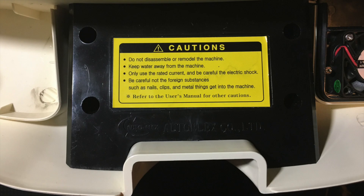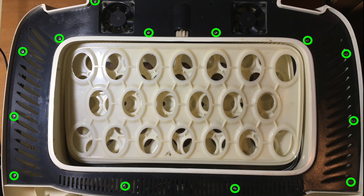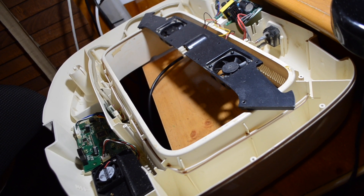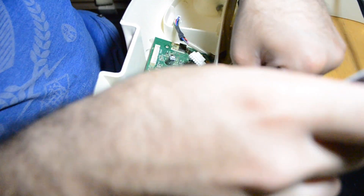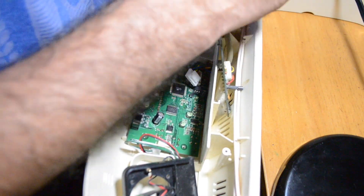I first ignored the warning sign since I never registered and I am out of warranty, and plus the manufacturer is in Korea. I removed the following screws and carefully removed and unplugged all of the cables. I first carefully pushed the cables to the sensor panel out of the incubator. Here I used an old toothbrush to gently remove dust off the sensor panel. I also loosened dust from the sensor slot area to be vacuumed later on. I did the same for the front areas of the incubator where air flow passes. I did find plenty of dust.